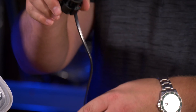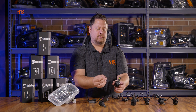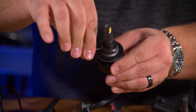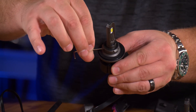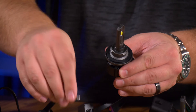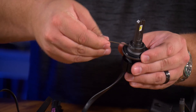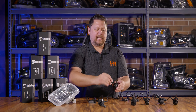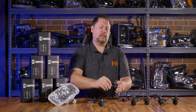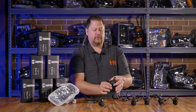If you install your bulb and it's misaligned, you would unscrew the set screw, align it so the chips are perfectly horizontal, and then replace the set screw. The H13 uses two set screws around the mounting collar. It comes with your Allen wrench. First, you have to undo the set screw on the front, and then undo the set screw on the back. Keep in mind you may not have to make any adjustments at all — sometimes these are going to line up perfectly with your assembly's reflectors.